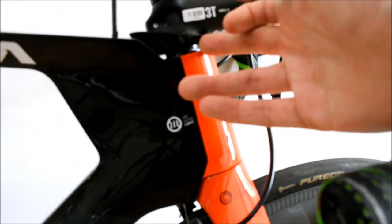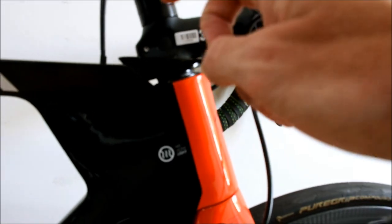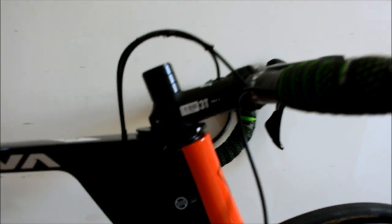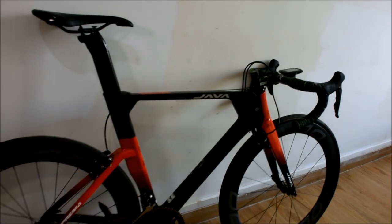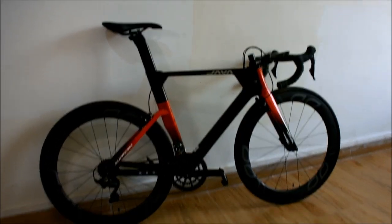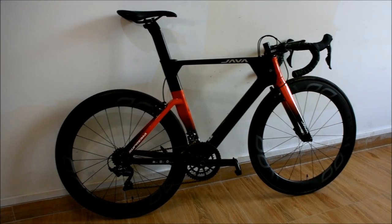What I've done is take a spacer off the top and move it to the bottom, which has created a bit of a gap — but that's just a 5mm spacer in there. I need to get a smaller spacer or even a thin 1-2mm washer and it'll sit flush again. I haven't been able to do that yet because here in China this is the middle — hopefully the end — of the coronavirus outbreak. I also still need to get the steerer cut.